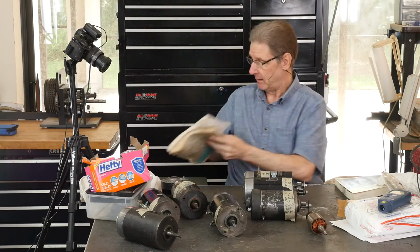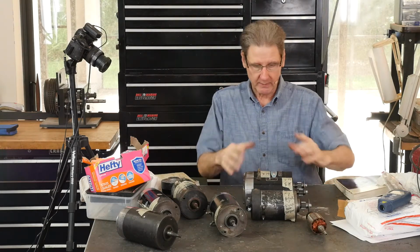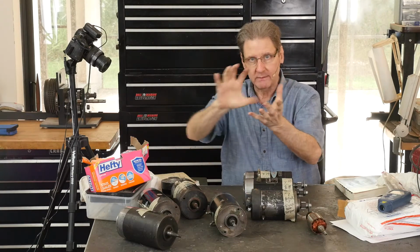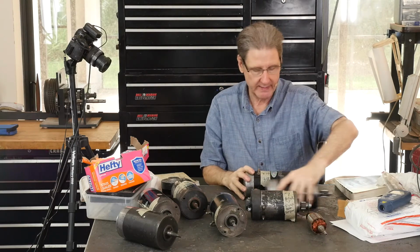29978-77A. Now, I'm told they'll fit in older bikes, but they're a little bit bigger. So I think you have to grind the case a little, right where that big tab comes down towards where the flywheel is. You've got to get in there and grind it a little.